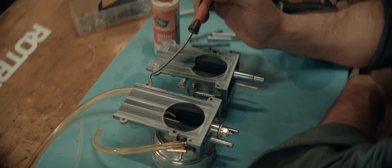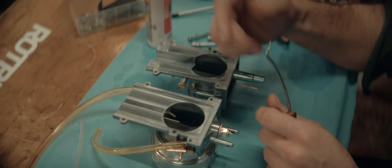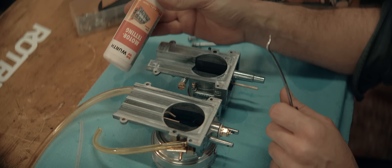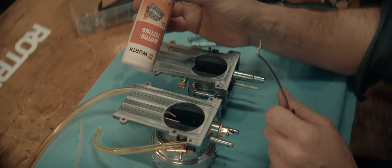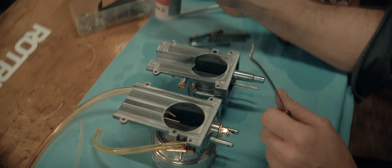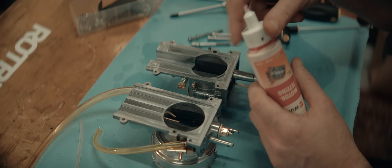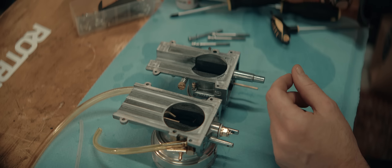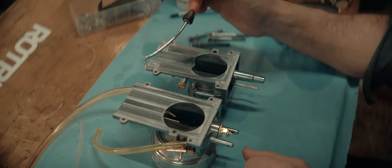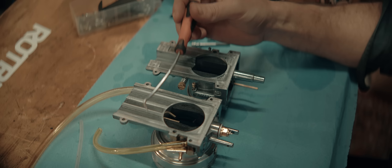From the looks of the remains of the sealant used here, it's probably an epoxy-based hard-curing engine sealant. That's great stuff but I think nitromethane or methanol is a solvent for it — even after curing, it just breaks down when exposed to methanol and nitromethane. Everything I've used this stuff on — cylinder halves, exhaust flanges, intake flanges — it has just broken down and started leaking. I think that's our problem. We'll try making a gasket. I'm a little concerned about how much clamping force these four tiny screws can provide — it might not be enough.